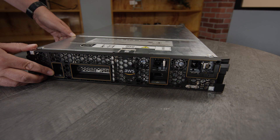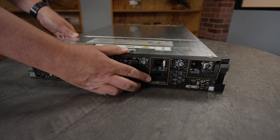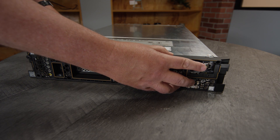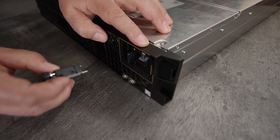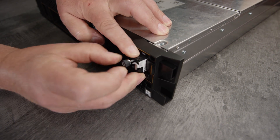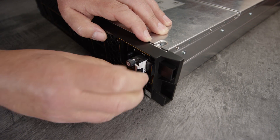The connection over here — the black cables in box A — will be used to configure or provision your server. Moving over, this is the QSFP plus port for your network cables. We have power cables, and then this is where the NSK key goes. So let's go get the key and plug it in. This is where the NSK — the nitro security key — goes. We're going to plug it in and hand tighten it. You don't need to crank it down with a screwdriver, just nice and snug — hand tight so it's secure.